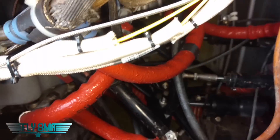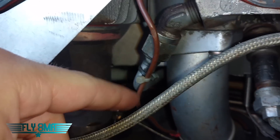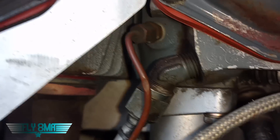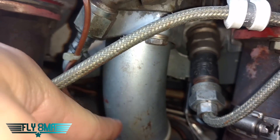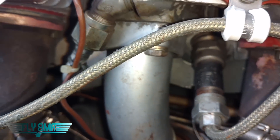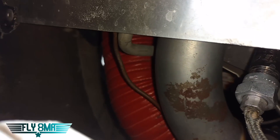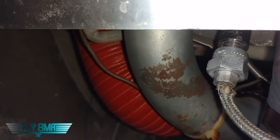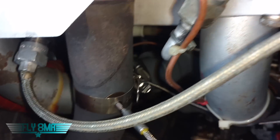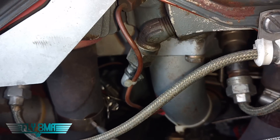It comes back out and goes directly into the intake side. So we can see where our skinny little copper pipe comes back up here where we'd shoot fuel directly into the intake side — that's our intake pipe there for that particular cylinder. So we're putting fuel directly to the cylinders to help it start easier. We have a primer on that cylinder and also one over on that cylinder — it looks like they're on all four cylinders in this engine. Some engines only have the primer on one or two cylinders, which is why it's harder to get them to start or easier to flood them where you have some cylinders with fuel and others without initially.